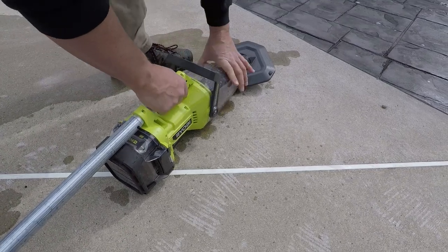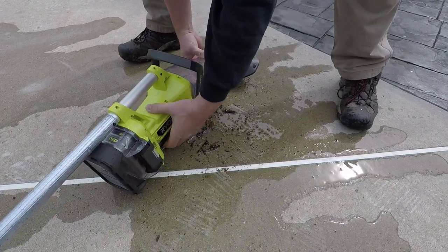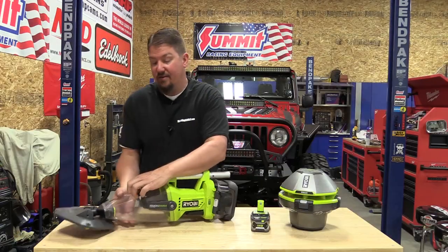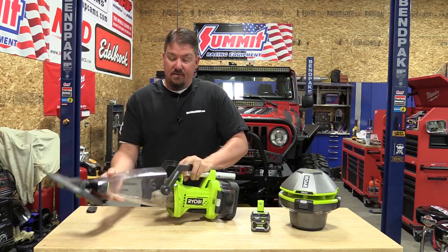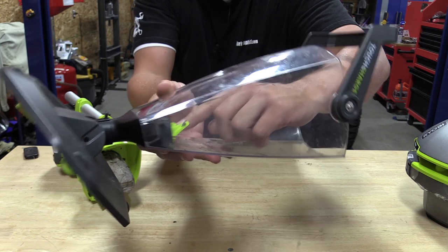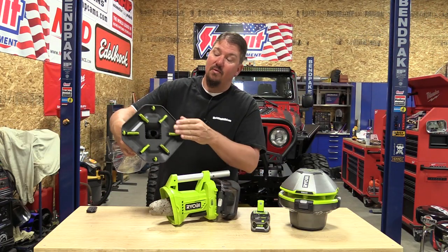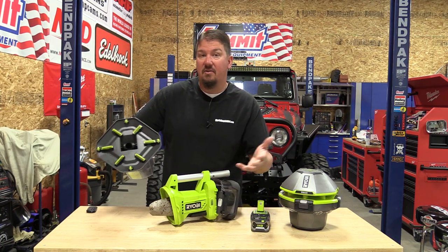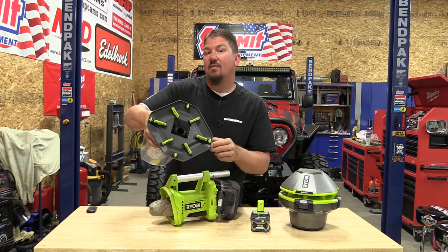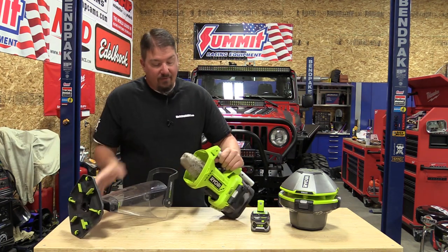For what I'm doing — using it 15 to 20 minutes maximum — I've never had it run out of power using either the 2 amp hour or 4 amp hour battery. You will have to take out the filter and clean it or remove the canister. The canister is simple: pull up on the lever until it clicks, slide forward, and dump it out. You can see it has some sand in it. There's a little green flapper that holds particles in when you remove it from the water — it's not perfect but it works well.